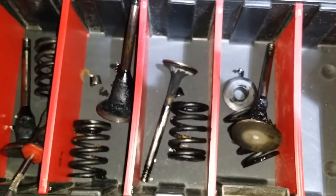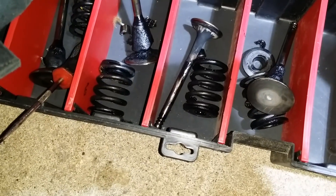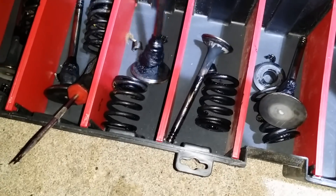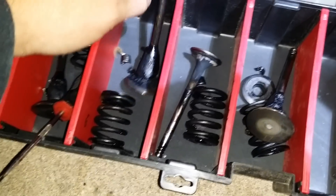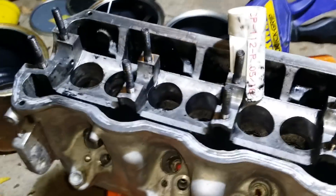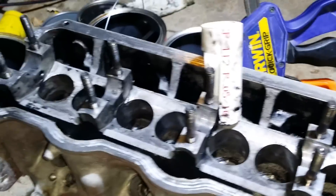My suggestion: never use a single tank, because if you do, there's your aftermath — catastrophic failure in the motor. I had to take the whole head apart. You can see the rings were completely seized up, almost every single one. Had to clean the block a little bit.